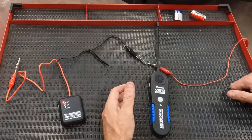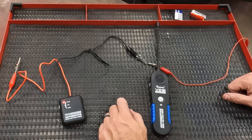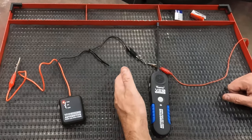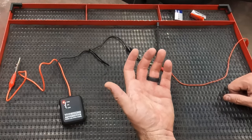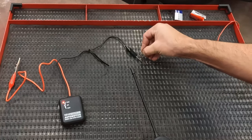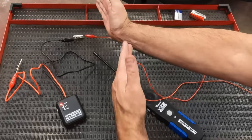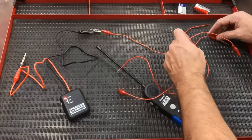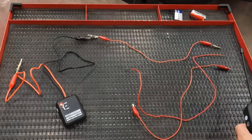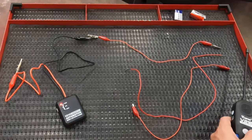If you're trying to find which wire is which — like everything is known to be good, you just don't know which wire is which — like if you've worked on a car where every wire is either red or black just because that's what was in the drawer, and you open a wiring harness and there's seven red wires, this can tell you which one is yours. You send the tone through that wire, and you can find out which one it is at the other end. You put tone on one red wire at this end of the car, then at the other end you scan the three red wires — it's not that one, probably not that one, getting a little louder — there it is. That's the one. So you can identify your circuit.